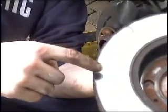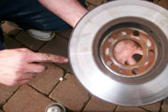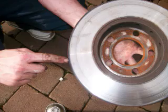On the brake disc you'll find a small lip on the outside of the disc. This lip identifies just how much brake wear you have. On most vehicles, anything more than 1mm each side of the disc will make the brake disc illegal. To check the legal thickness of the brake discs on your vehicle, you can call the staff at Carparts Direct and they can advise immediately.